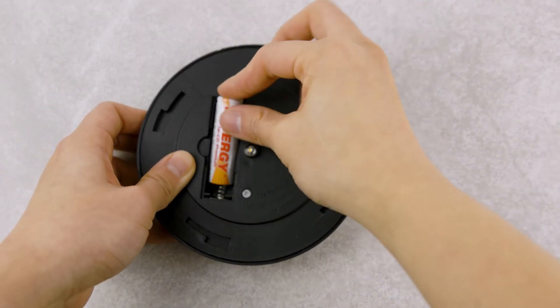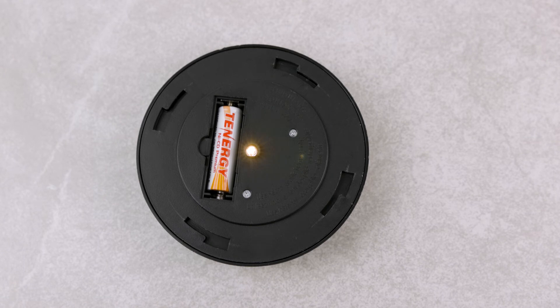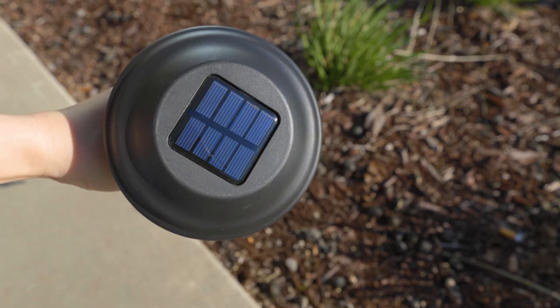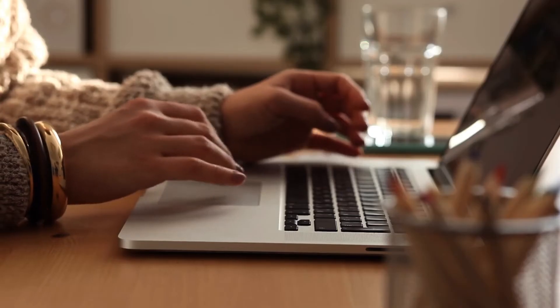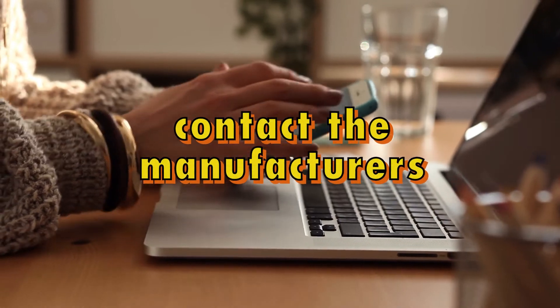However, if those batteries are recharged to full and work on your light or device, then this means that the solar light didn't give enough power to recharge your batteries. You can try to fix this by cleaning the solar panel if it's dirty, or try moving the solar lights to a different location to get better sun reception. If none of this fixes the problem, try contacting your solar light manufacturer for further help.